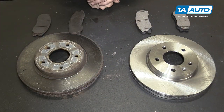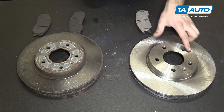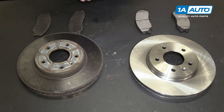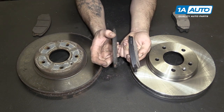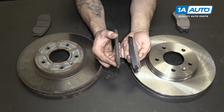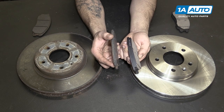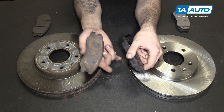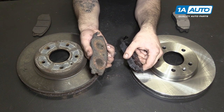Here we have our old brake pads and rotors that we removed from our vehicle and our new parts from 1AAuto.com. As you can see, these parts are exactly the same with the same size rotor. They're also vented. They have the same five-bolt lug pattern, same center bore, and the same bolt location for your rotor screw. Same brake pads — you can see why it was time to change these out. That's almost completely worn away. These probably had a couple thousand miles left on them, but it's a lot better to change your brakes just before they need it rather than after the fact to make sure that your vehicle is always operating and stopping safely. Each side also comes with one of these brake squealers, which is designed to start dragging against the rotor and making some noise to give you an audible alert that it's almost time to do your brakes.